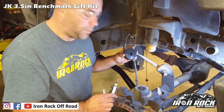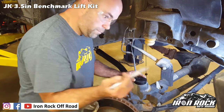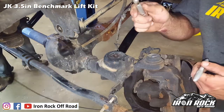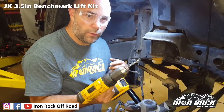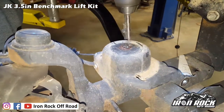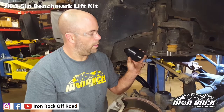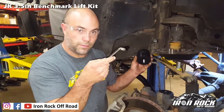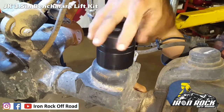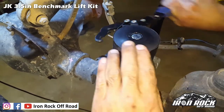We're going to install our optional stackable bump stops. First step: eyeball the center, mark it with a silver Sharpie. Use an automatic center punch if you have one, then drill with a small bit first to get the center location perfect. Make sure to peck drill and use plenty of oil. Put some blue Loctite on the bolt, install the fancy flag nut, and get as tight as you can with your bare hands. A smaller size oil filter wrench works great for final tightening.